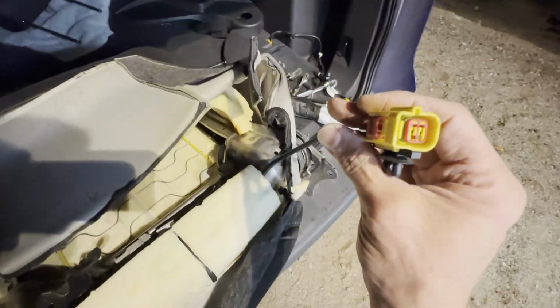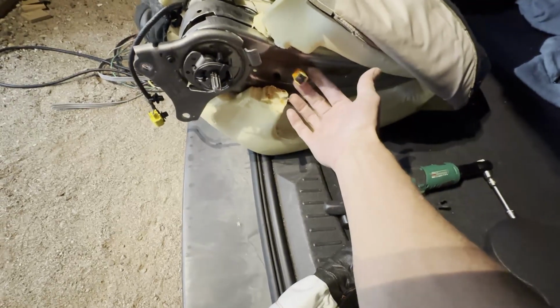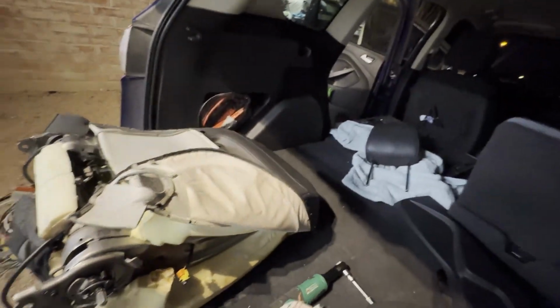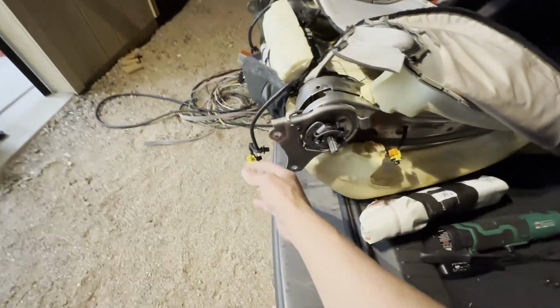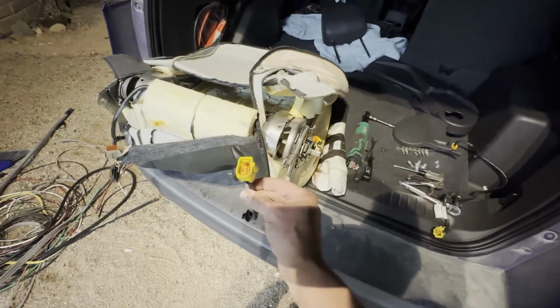And then again, we've got the exact same connectors. And I think this is my saving grace. Because that connector is the exact same, I don't have to redo this wiring bundle. I can just leave it all in place and just hook this into the new one. Theoretically, this is a slightly different shape than the deployed one because the side of the Escape is slightly different than the Focus. My guess is the difference in the connector is what this plugs into in the base and how that connects to the car. That's probably where the difference is going to be.